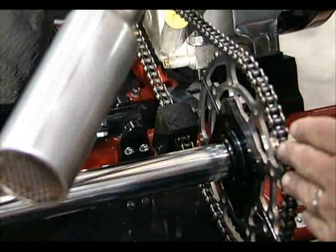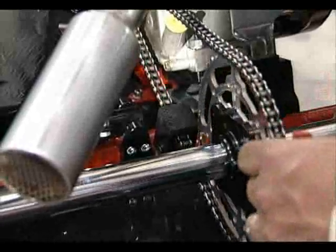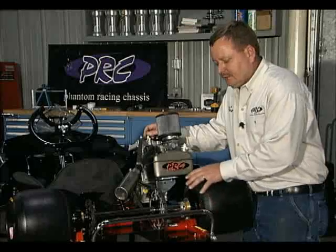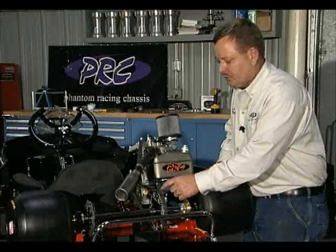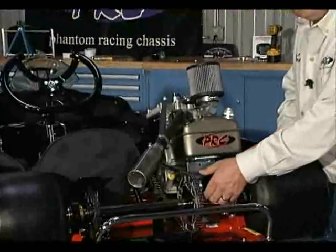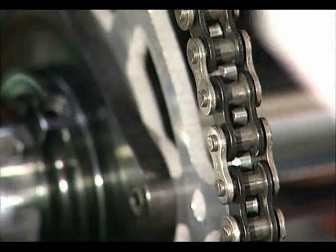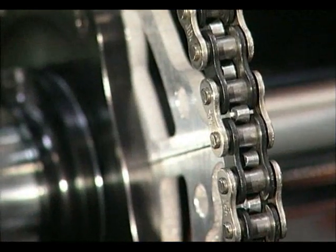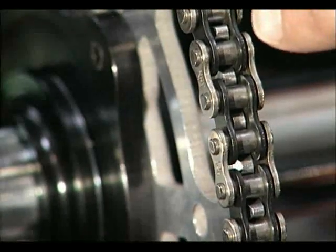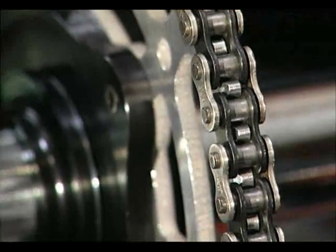Now what I want to do is get my rear gear aligned properly to my front sprocket. Some people use lasers and straight edges, but what I do is set mine based on how the chain runs in the sprocket. The way I finally line my chain up is I turn the axle assembly backwards — this simulates what happens on the bottom side of the gear. I spin it backwards and make sure the gear is running in the center of the chain. If it's not, I'll move the sprocket over to whichever side it needs to go. You can see the gear is tracking to the right hand side, so I need to barely push the gear to the left to get the gear away from the chain.